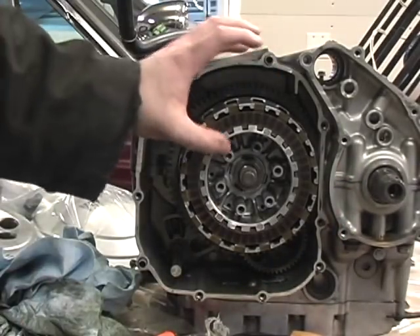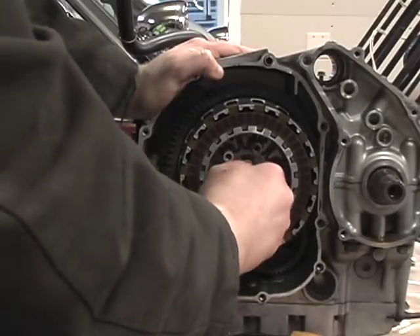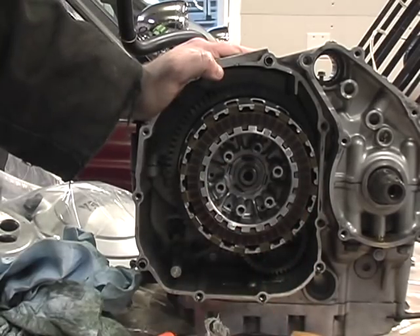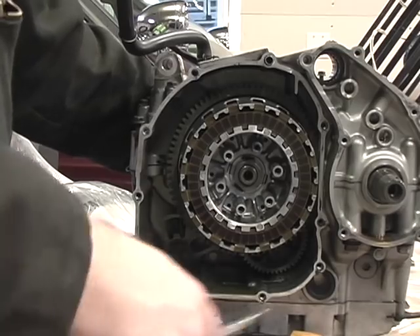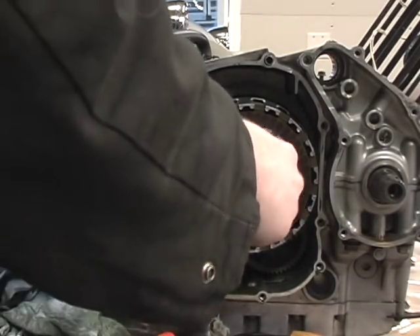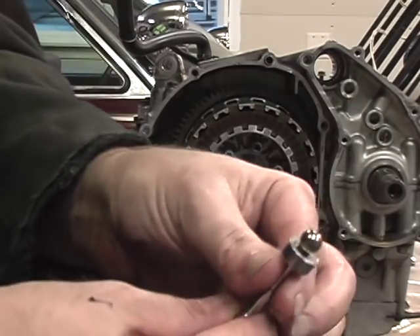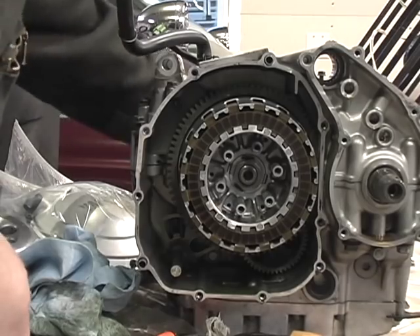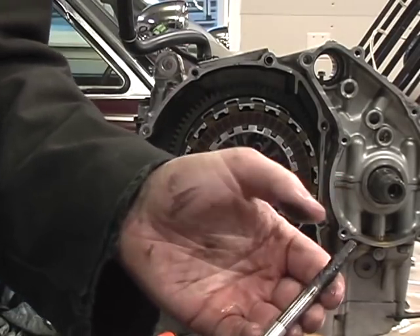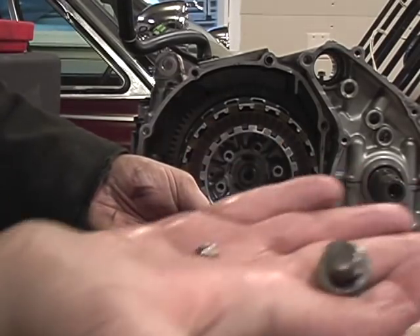We're removing the outer pressure plate now. This is the inner basket with the posts, and this is the main nut you need to release — we've got to get that off before we can pull this off. This top hat has an O-ring on it and just pulls out. Behind this is the infamous little ball bearing. The push rod — which the clutch pushes on the opposite side — pushes against a roller ball bearing to make operation smoother against the top hat. Take your magnet, put it at the end here, and push the push rod from the other side; that will drive the ball forward. Make sure you bag the ball bearing or you'll have to buy a new one. Then take out the push rod from the opposite side — it's dirty, but it just slides out; there's nothing holding it in. Bag the top hat and the ball bearing.